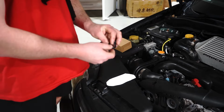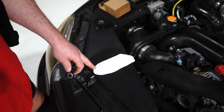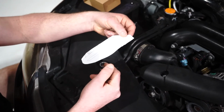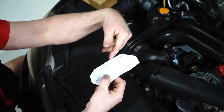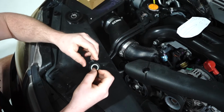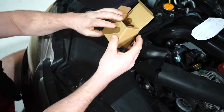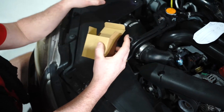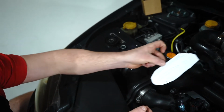At the same time, we're going to be replacing this little nut that goes on the back of this unit. To do that, it will be underneath this. You use a rattle gun, 14mm again, undo this adjustment nut, pop it off, remove the bracket to the side. You've now got your old little nut. It can go to the side as well. And at that point, you would grab your Parts Factory replacement, which in our case is obviously these two. Bring them out of our box to the side, the new bracket.